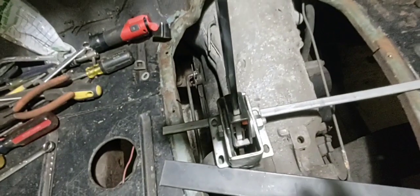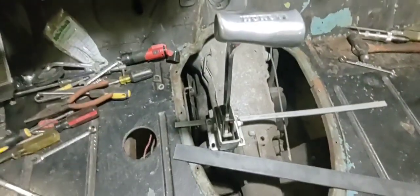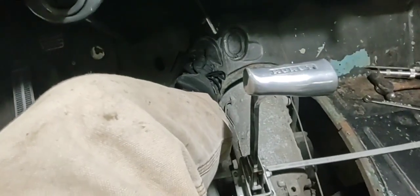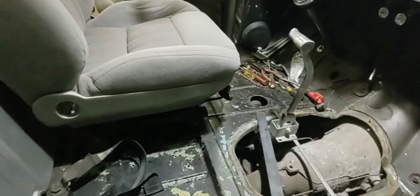See that threaded rod down there? I threaded it about another three inches, which moved that shifter up towards the firewall. Now that position would be park, and first gear is about right here - the gas pedal goes where my foot is, so it's plenty far out of the way. That's much better. Check it out from the other side - yeah it looks cool, way better. Now you can actually see the shifter.